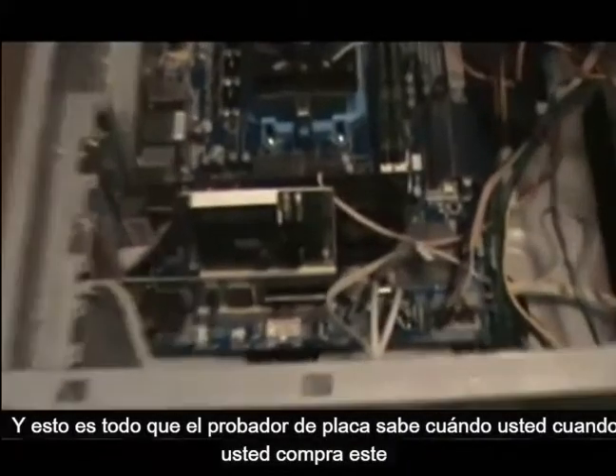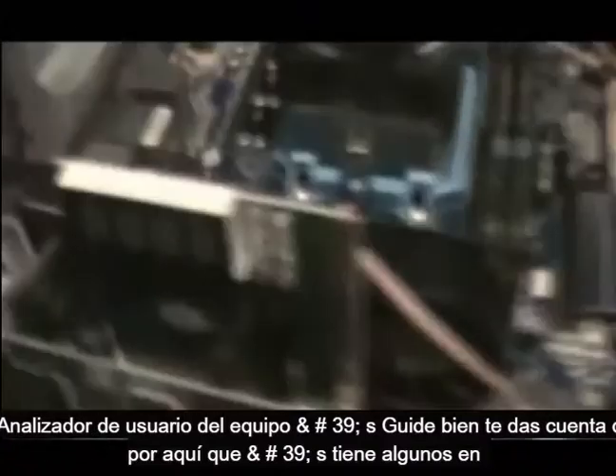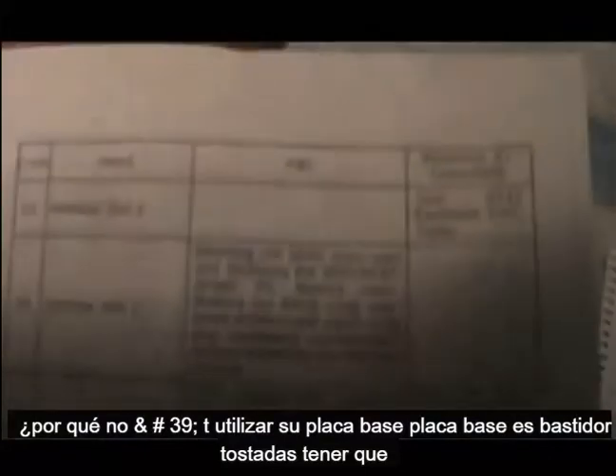It's pretty easy — we just go in here, remove the video card, and it fits right in. Push it in — there it goes. When you buy this motherboard tester, it's going to come with a little booklet — a PCI analyzer user's guide. It's going to give you a code. If your motherboard is bad, it's going to give you a code. If your motherboard doesn't do anything, doesn't even light up, it means your motherboard is toast. The code tells you the problem — it could be your RAM, it could be a lot of things. Use the user's guide to look up the code.